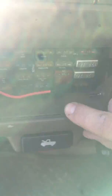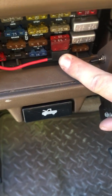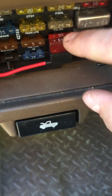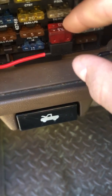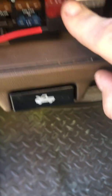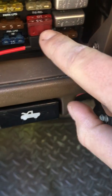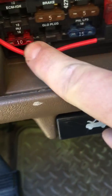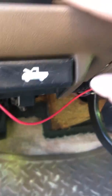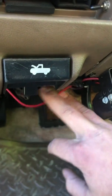We start here in the fuse box. Just use a fuse tap. The fuse I pulled out was the 10, and the 7.5 is the fuse that I put in there. There's a wire from that fuse tap — this gets power right here when I turn the key to the run position.